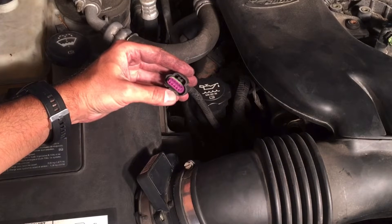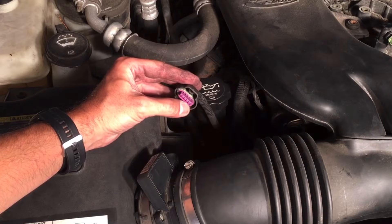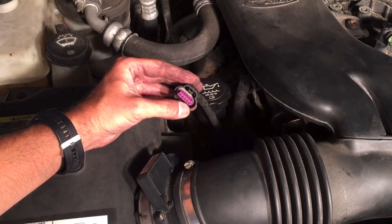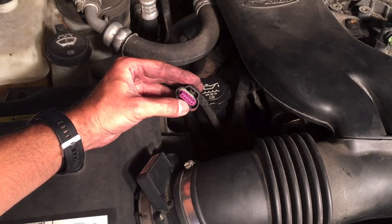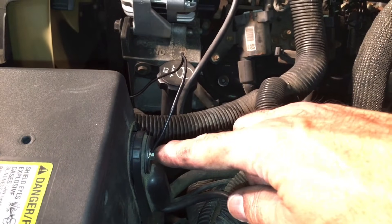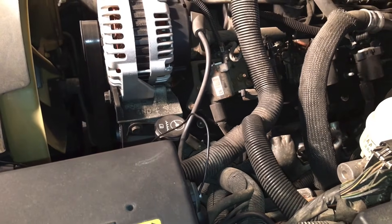Here's our harness that goes into the mass airflow sensor. On this particular one, we have five little tabs. What we're going to do is turn the car to the power-on position, ground the multimeter on the battery, and then use our positive lead to test each one until we get our voltage reading. That way we can identify the 12-volt power coming in. Here's our connection to the multimeter coming into the negative on the battery terminal, and now let's connect the positive after we turn the power of the car on.